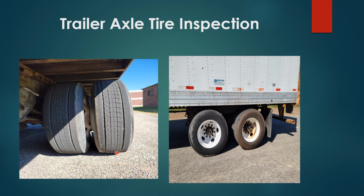Trailer axle tire inspection. Inside of tires, outside of tires. No cuts, no bulges. Nothing wedged in between tires. Tires are worn even. They have more than 2/32 inch thickness, and they're filled to proper level, 100 to 120 PSI.